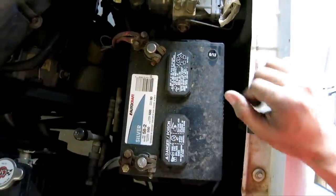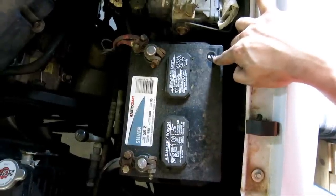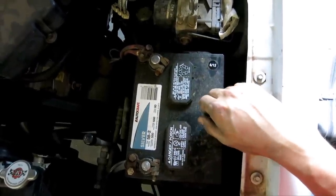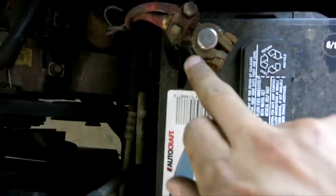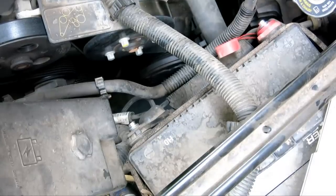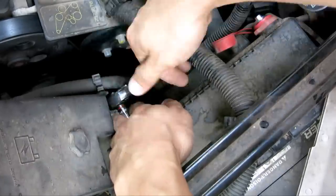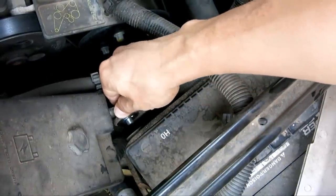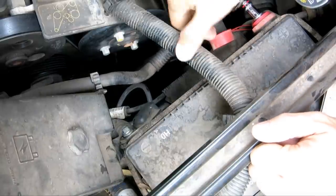Your car battery might have the manufacture date on the top corner like this one — produced June 2013, probably has a two year warranty, so I still have about another year before I need to worry about it. This is the positive terminal — you can see the plus sign and the red wire indicates positive — and the black wire indicates negative. So here's the negative terminal. I want to remove the screw on the negative terminal first. You'll see some sparks — do you see right there? It's completing a circuit but it won't harm you even if you touch the lead. It looks scary but it doesn't harm you at all. Now let's release the positive terminal.